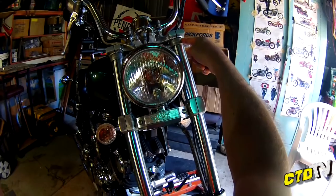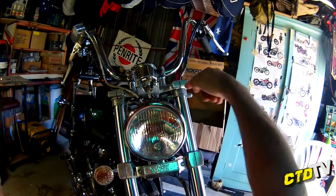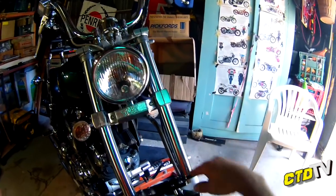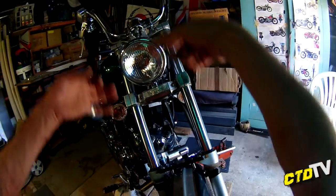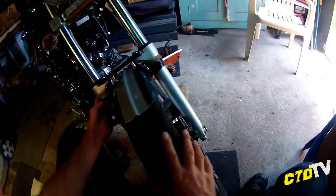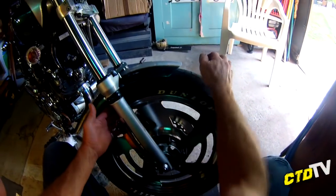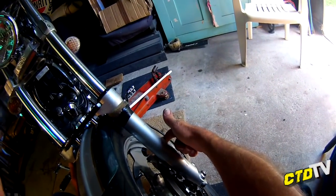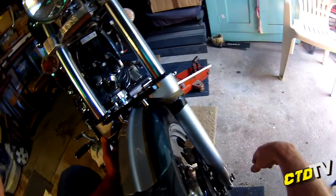That there is just a pressure stabilizer. It's just a tube in between, and it holds the air for both, same pressure. That will slide up and down, so that'll come off easy. The wheel definitely has to come off. So, axle. And the caliper is obviously going to come off, to swing away and just stay somewhere while you're doing the job.